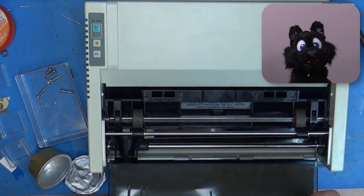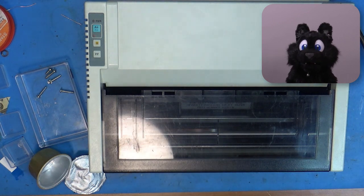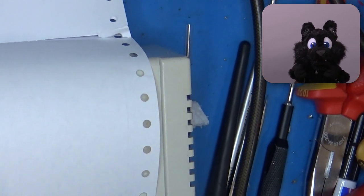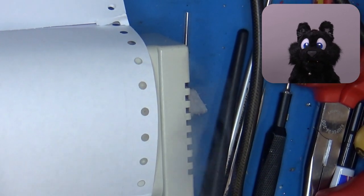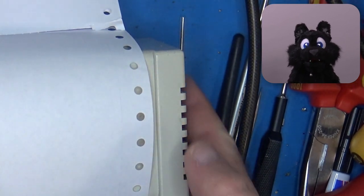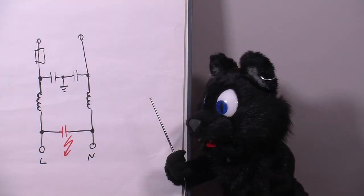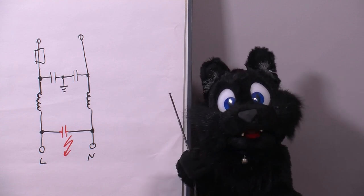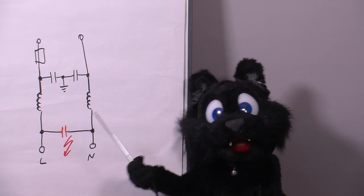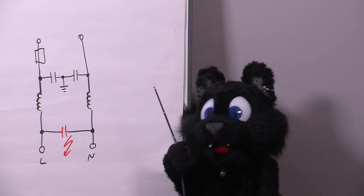But right when I turned away to get some cables, I heard a slight pfff. I turned around again and saw a thick wad of smoke emitting from the printer — yikes! I quickly pulled the plug and opened the window. Turns out the mains filter element has a capacitor between line and neutral, and that decided to pop. The smoke most likely came from the tar-like potting compound that melted in the process. Stinky stuff!